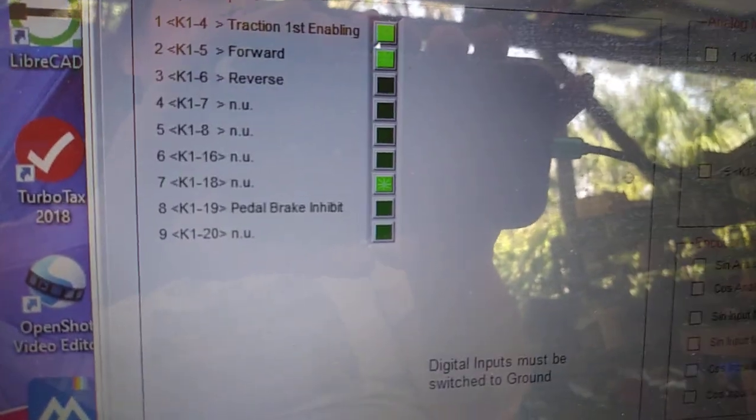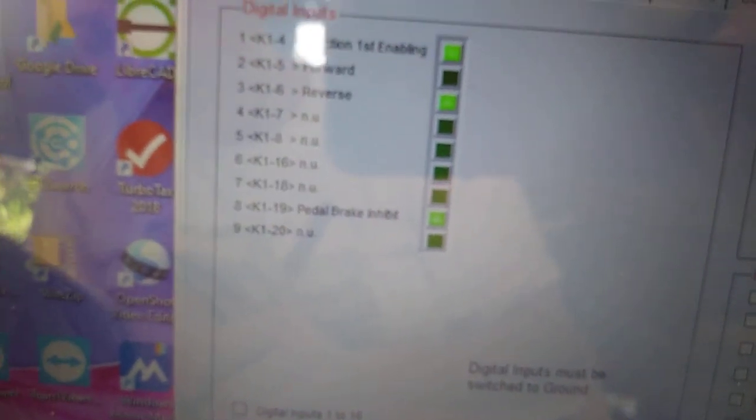I'm going to write that down for labels. So you see that green box lit up that says brake inhibit profile three. When you have that profile on and you give it gas, it won't go. That's basically what that is doing — it's like when you put your brake on. It regenerative brakes until it stops, and as long as you've got your brake on, it won't go. Turn your brake off and it goes.